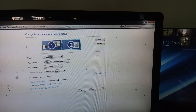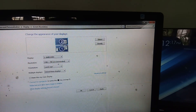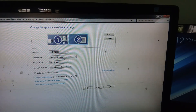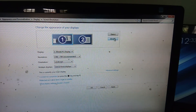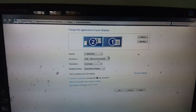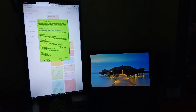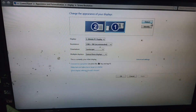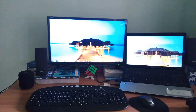You can also set your dual display arrangement as you like by changing the position of one monitor relative to the other — just press and drag it to the top so the first is at the bottom and the second is at the top. If you're confused about which is monitor one and which is two, press Identify to see numbers on each screen. You can also change the orientation to portrait for either or both monitors — this setup is mainly used by professional bloggers or programmers. To set a main monitor, check the 'Make this my main display' box and press Apply; the taskbar will indicate which is the main monitor.